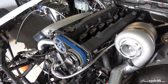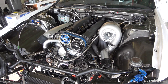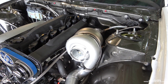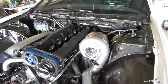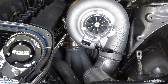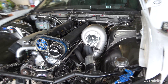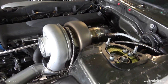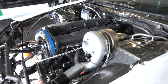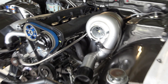It's the same head as what I had before — that head has done 1400 horsepower in the past, so it definitely flows. That's a G42-1200 Garrett turbo, quite a big unit. Still the same exhaust manifold V-band, got a 1.28 exhaust housing on the rear, and still running all the EGTs to get some additional tuning visibility over the engine.